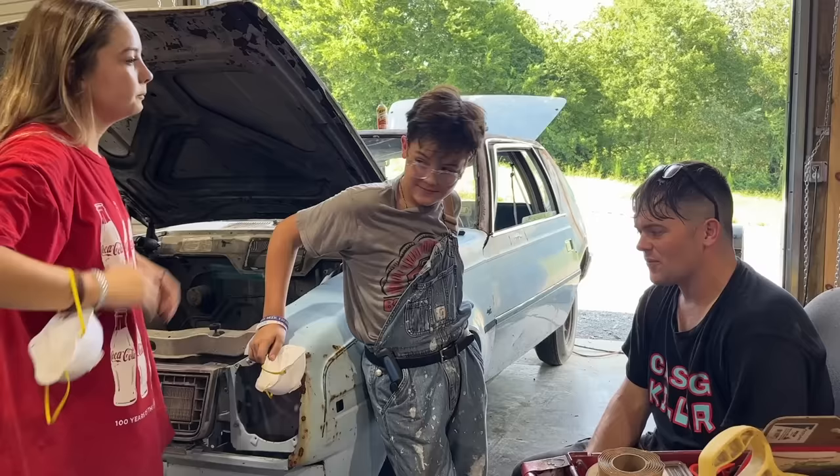This actually has a bolt-in pin — usually they have a funky clip that's really hard to get on or off, but I actually like how this bolts in. We've got a little drain hole on the floor. Here's our old master cylinder — we'll probably reuse the push rod part but I'm not planning on using that master cylinder. Here's what we're going to replace it with: an aluminum master cylinder, the same kind I ran on the Starlet.